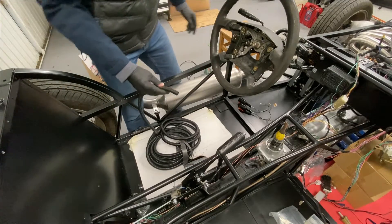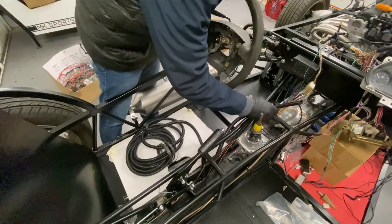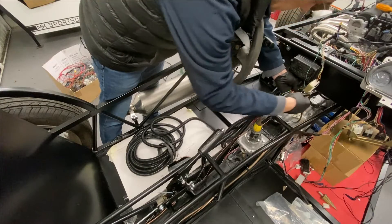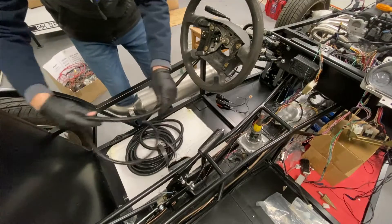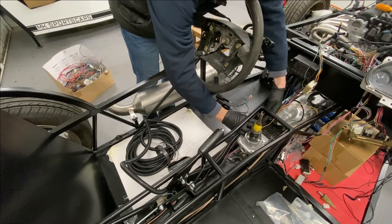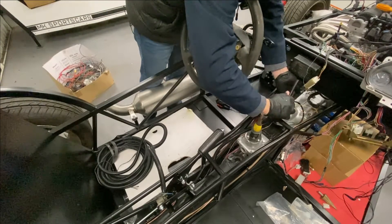You can't see the back — we'll come around the back in a minute. There is a small modification we need to make to the wiring loom at the back of the car. So we do the front bit first, working forward, putting everything in the split conduit. Up at the front end here, this will tidy everything up. I'm going to get a head start by routing this split conduit through in the direction I need to go, because it will be an absolute pain otherwise.